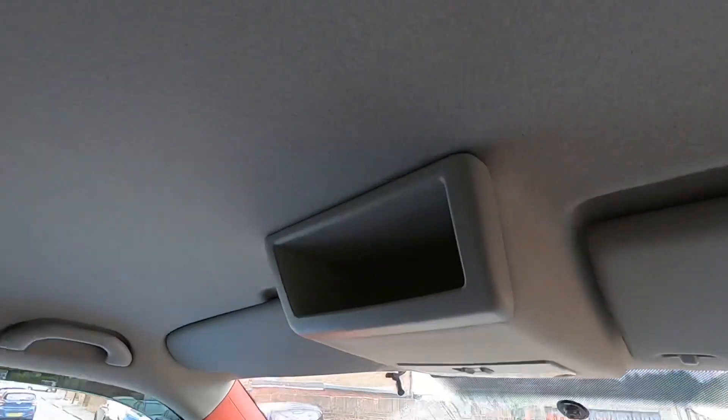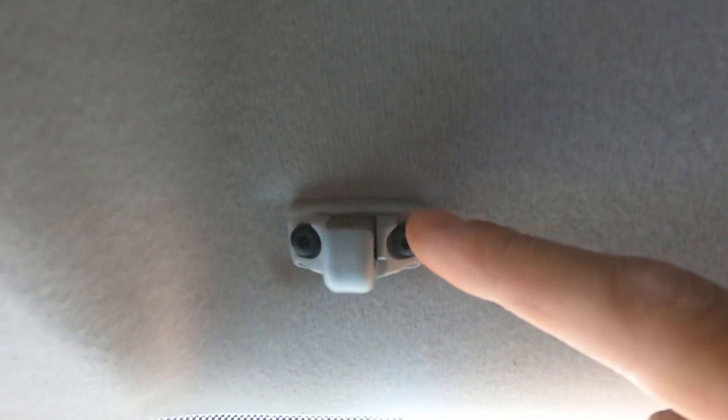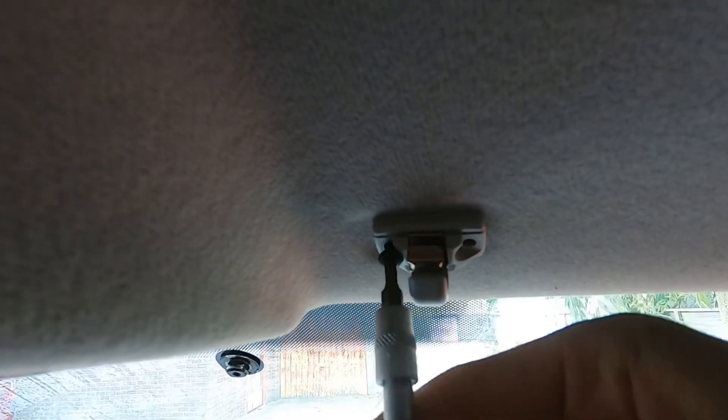The first thing I'm going to do is pop the driver's side sun visor out — that just clips out like that. Up here there's a little clip thing that needs to come off; there's a little tab in there, perfect size for my flathead. I'm just going to push that in and gently turn the flathead screwdriver — there you go, that pops off. Then there are a couple of T20 Torx screws on here, so I'm going to pop them out next.